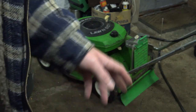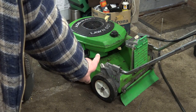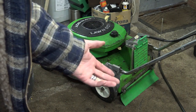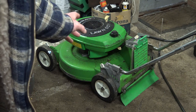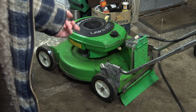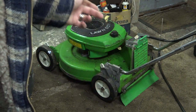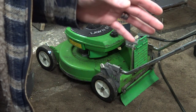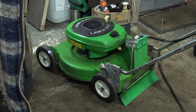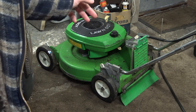For those of you going to say it sounds like it's running fast — I had it on full throttle, I forgot about that. The throttle is underneath there, on top of the air filter, there's a little lever. You've got hare speed and tortoise speed. The handle's broken off, it was like that when I bought it. I have the tortoise speed set to a nice low speed for cutting light grass, and I turned the hare speed up a bit because I was cutting some really thick, long, damp grass last summer. That got through it no trouble at all on the high throttle — that's why I had it like that. It was running a bit fast, I know.